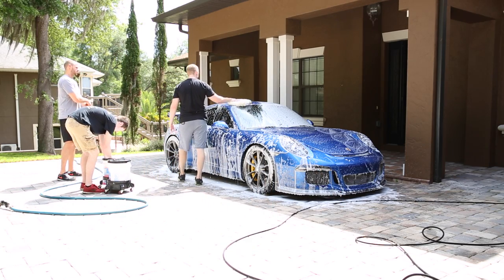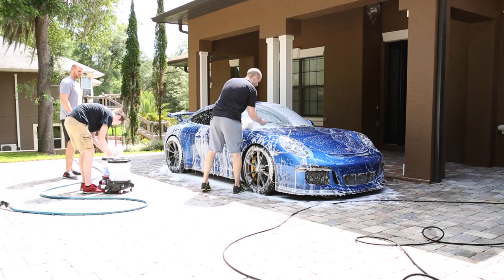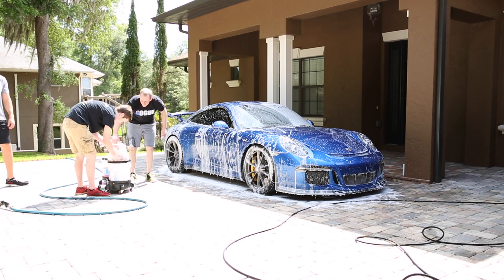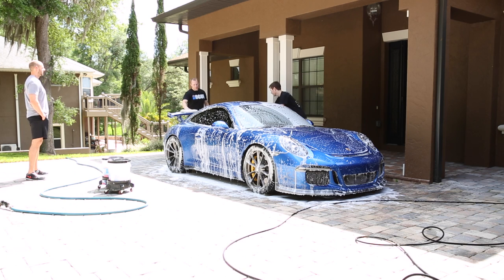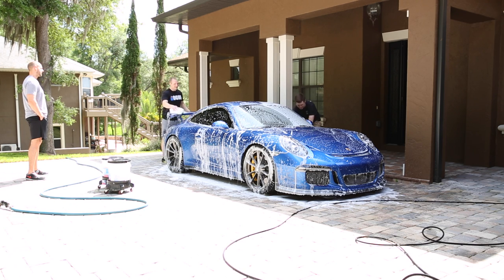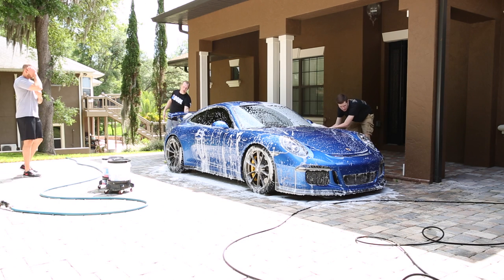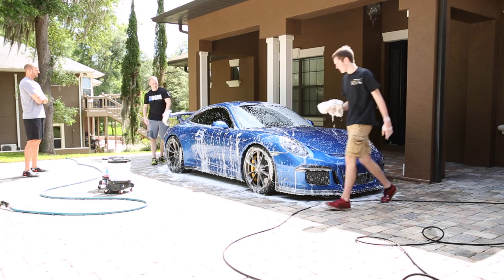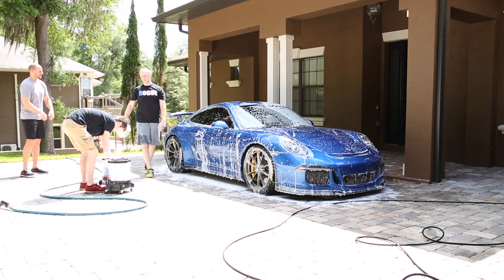Notice as I'm doing this I'm not driving the pad into the paint — I'm just dragging it across. Start at the top — go from top down. The key to all of this stuff is not about doing it perfectly. I'll argue to the grave that the key is to find a process that doesn't scratch the paint. If you figure out a process where your paint doesn't get jacked up, that's all you really need to do. Notice I'll do one section and I'll flip the pad — all simple stuff that makes common sense.